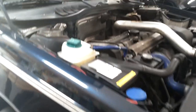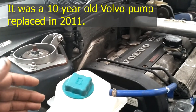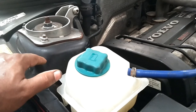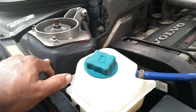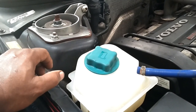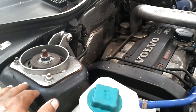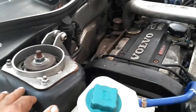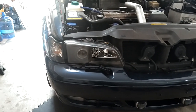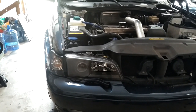The owner said coolant was leaking before he did the water pump. He thought it may have been the water pump, so he changed it, and it progressively got worse. So there's a good chance that water pipe is leaking. We're going to get under there and jam a tissue up there — see if the tissue gets wet. If so, we're going to start tearing this apart, pull the exhaust manifold, pull that pipe out, and get her done.